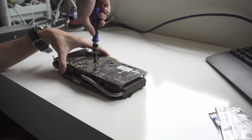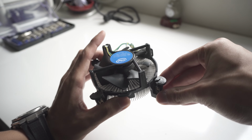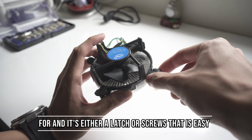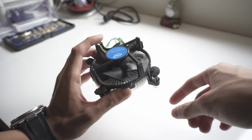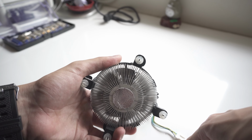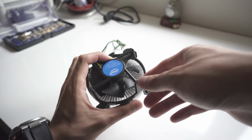You gotta unplug it yourself, if not you can damage it. For CPU wise, if you have an Intel platform, there should be locks. Just turn them so that the arrow is pointing towards the heatsink. Then just pull out all the tabs. You could either get another Intel heatsink, or you can repaste it and clear out the hard to reach dust in this heatsink first.